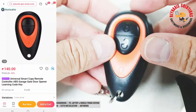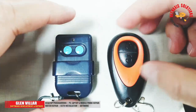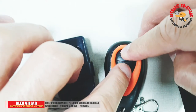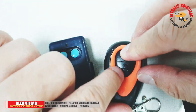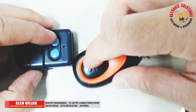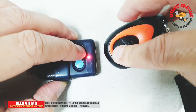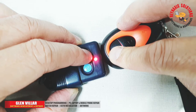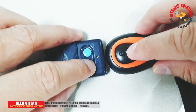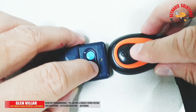I have this other type also, and while it looks different on the outside, the process of cloning is pretty much the same. You also need to press the up and down button at the same time until you see that the LED light flashes. Make sure that you press the open button three times in quick succession. Now the first button of the original remote control is button number one, and the first button of the cloned remote control will be the top button. Just follow the same instructions that we assigned to the previous two remote controls and the cloning process will proceed as usual.